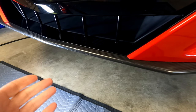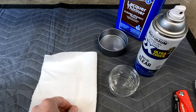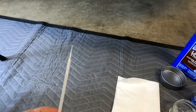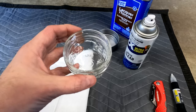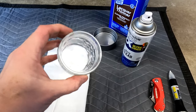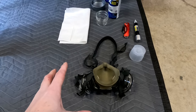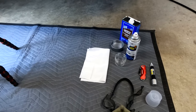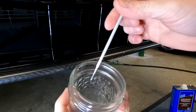Now that I've made sure I have a surface the paint will stick to, I can commence with the next step. I've taken some lacquer thinner and put it in a container because as I'm painting I may need to clean my brush. This is my brush — there'll be a link in the description below. It has a tiny fuzzy head on it, about one millimeter. The whole point is to take this and just lay the paint right in that hole and then add more paint. I take my spray can and spray it into a glass container — you don't need much, just spray a little bit in there. I'm going to put on my mask because as I spray I'll get some vapors in the air and I don't want to inhale that.